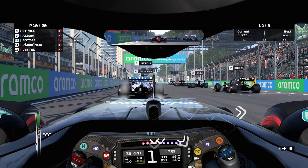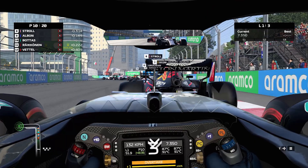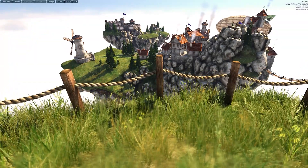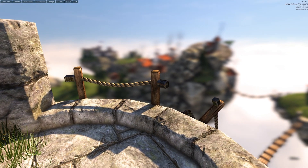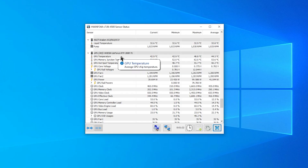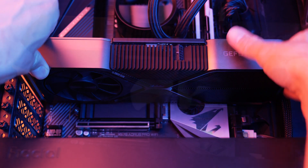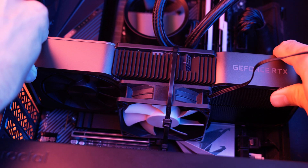All tests are done in my closed case, so the results are as real-world as possible. I will be running three simple tests: the first is F1 2020's benchmark mode — three laps of Azerbaijan on Ultra settings with DLSS off. The second is a pass of 3DMark Time Spy. The final test is Unigine Heaven on Ultra, left running for 10 minutes before starting the benchmark to let GPU temperatures reach equilibrium. All temps were collected with HWinfo's average GPU temp reading. The first run is stock — GPU clock, fan speed, everything. For the second, I'll be attaching the fan to the center of the GPU shroud to push air into the thicker fins in hopes of dissipating some extra heat.